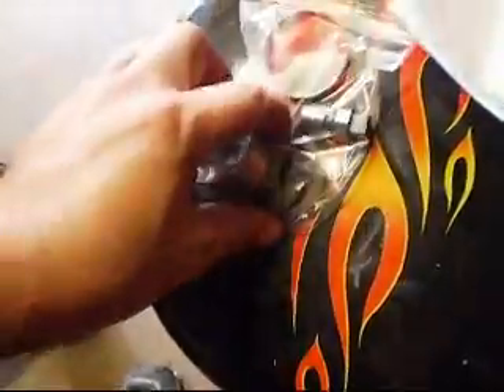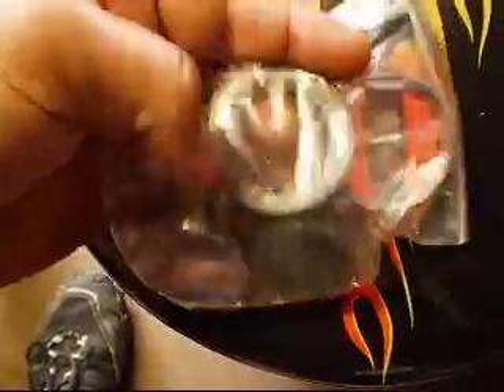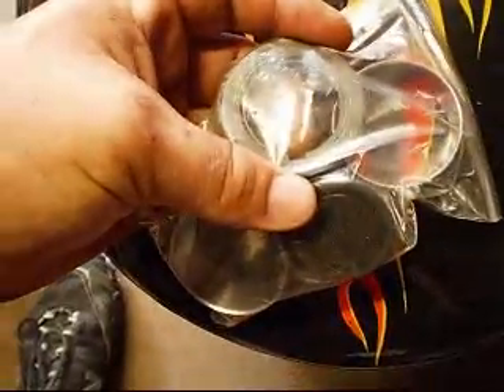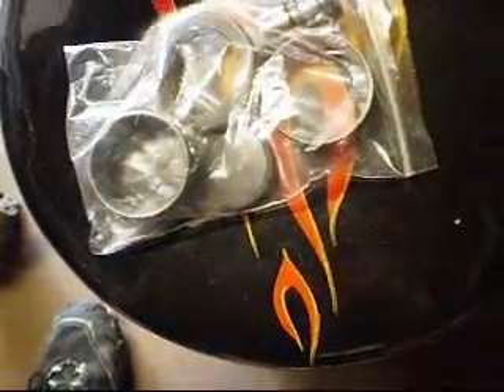Also along with those, instead of a freeze plug here, I have a rubber and copper stamped rubber plug, along with this gear which is a replacement. If you're not using a balance shaft, then why continue to have the sprocket on there? So this spacer here — provided by the kit — replaces that sprocket. I'll get everything out of here opened up and I'll show you how to install it as I start to install it.